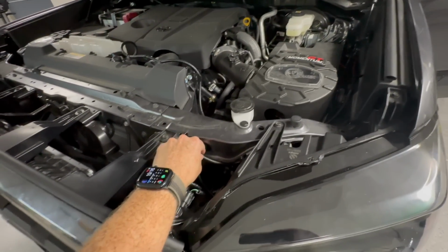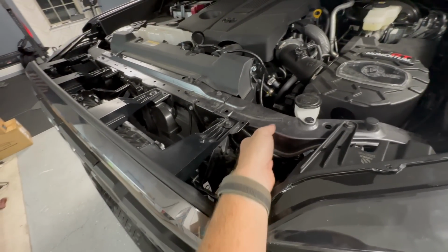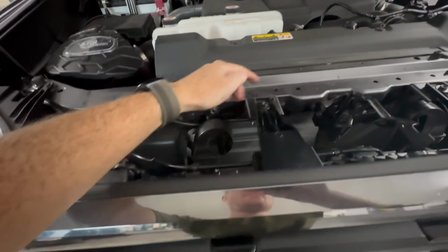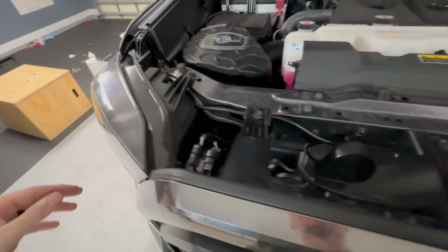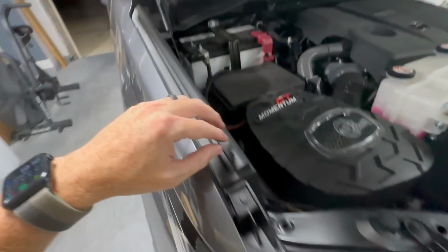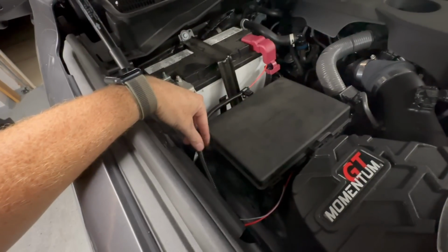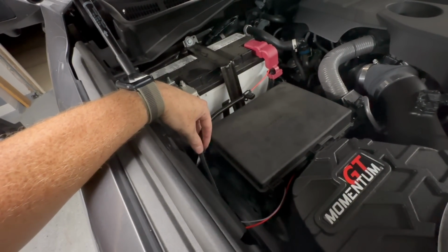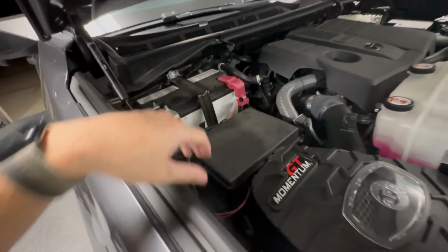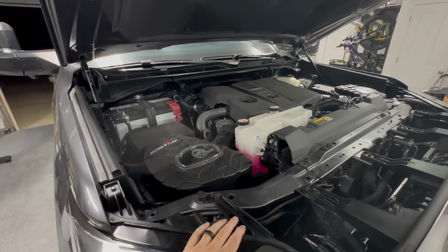And then the positive wire for the light bar, I put into this little loom right here. I ran it across the whole radiator section, zip tied it up so it's all across this cross member right here, or this cross brace I should say, comes up right in through here and then into the positive battery. And it was a little bit short. I should have made it just a little bit longer because it was running up along this channel too, but it was just a little bit short. So it's still just temporary until I get some sort of switch set up in this truck.